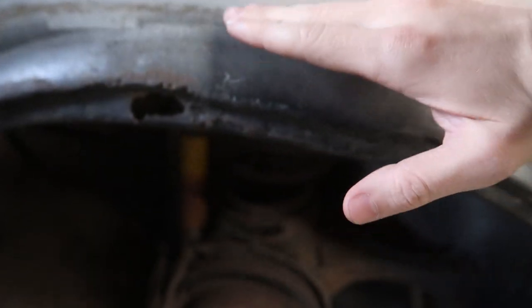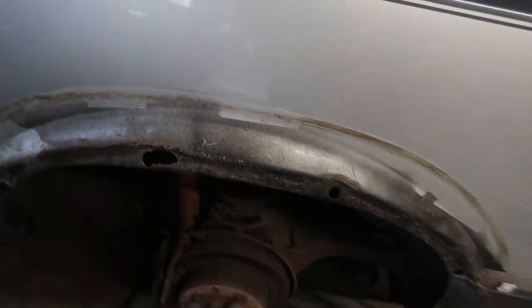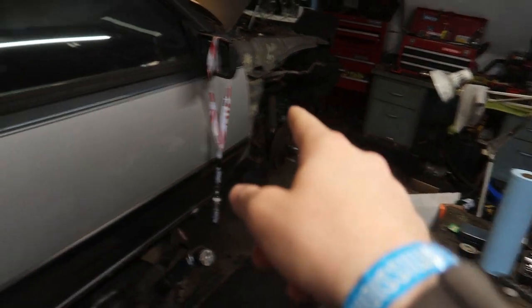There is definitely going to be rust on the inside. One cool thing I saw some Mark II guys doing is the front fender flares and the rear fender flares are a different size — the rears are less aggressive. There have been guys who modified front fender flares to fit on the rear so that it's squared all the way around, and it actually looks a lot more aggressive. The front fender flares also sit higher on the body and don't hang as low, so it's easier to go lower in the rear with the front flares on the rear.